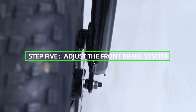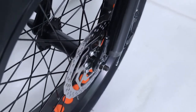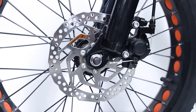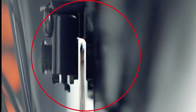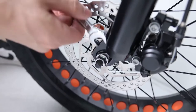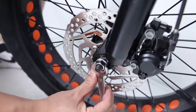Adjust the front brake system. Notice, the adjustment of the front brake system is not easy. The following steps are only a general guide to assist in the adjustment of the front brake system. Consult a certified, reputable bike mechanic to assist with it. The end goal is a caliper that is parallel to the rotor with an even gap of 2 to 3 millimeters on each side and an adequate lever feel. Before adjusting the front brake system, make sure the axle nuts in step 1 have been tightened.